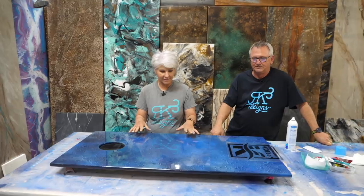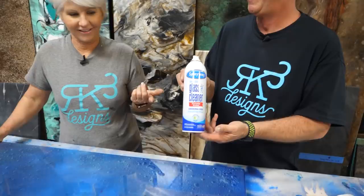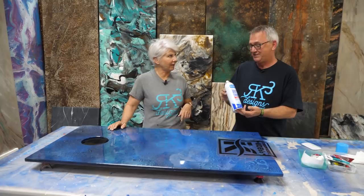Our first clear coat has dried overnight. Now we have a special guest — Keith McGinnis from Eagle, Nebraska, whose business is KCDC Designs. He's here for our pro class, so we're putting him to work. Keith shared a pro tip: use foamy spray foam glass cleaner, which is going to be a miracle worker for getting the logo on really easily. Back in the day when cars had wood grain paneling on station wagons, they would use spray foam glass cleaner to apply vinyl decals.